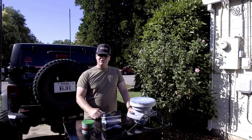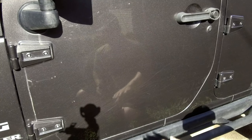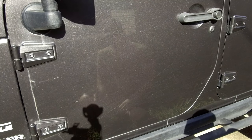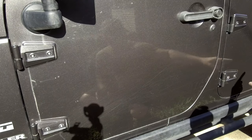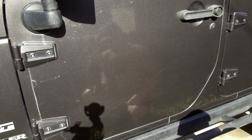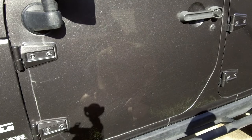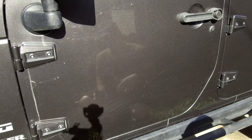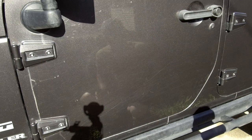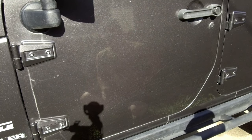Okay, let's get started and show you just how easy it is. I was out this past weekend doing a lot of wheeling and the trail was really overgrown. As you can see, there's a lot of pin striping that goes all the way down the doors. One way to see if it is a clear coat scratch or anything deeper is to get it wet — most of the time once you get it wet the scratch is going to disappear for a little bit. Either that or run your nail over it. If you feel a deep valley in there then it's not just a clear coat scratch and it's not going to buff out — you're going to need something a lot more labor-intensive. Luckily these are just clear coat scratches and they are going to buff out.